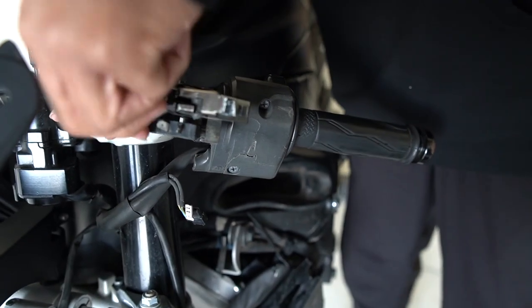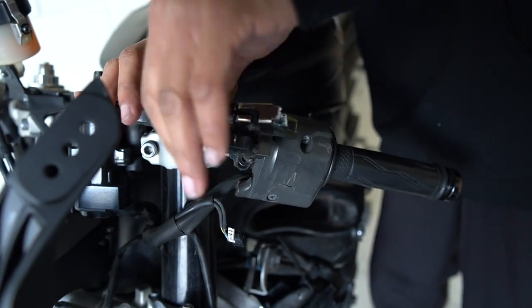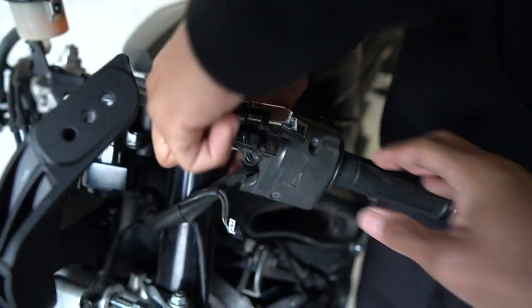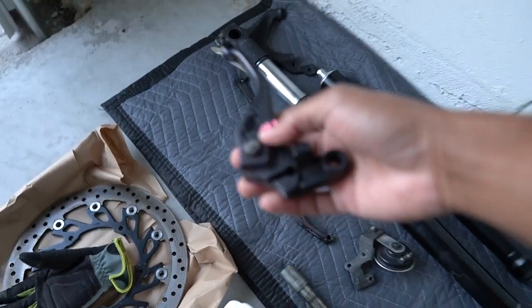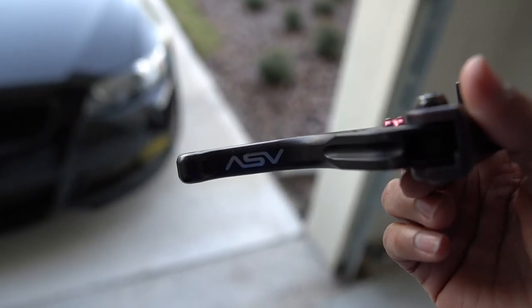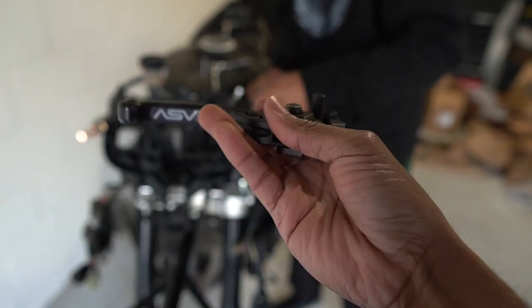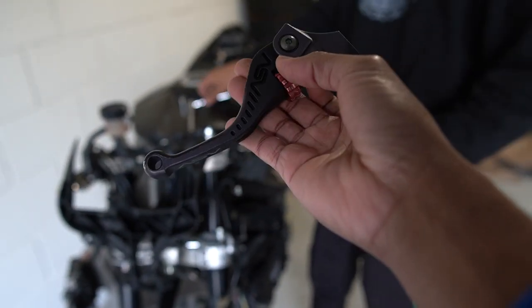Now I'm going to replace the levers. To take them off it's pretty easy — held in by two screws, one on the side and one on the back. I'll unscrew those and also disconnect the clutch cable. The replacement levers going on are ASV — pretty good quality. As mentioned, they were on Kirk's old R1, so we'll put them on until we get the new levers, and we'll be talking more about those parts in upcoming videos.